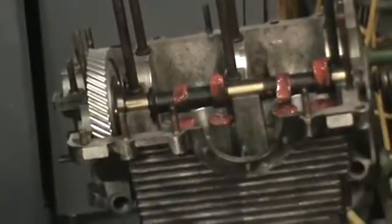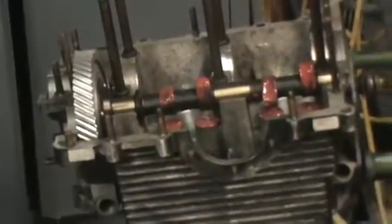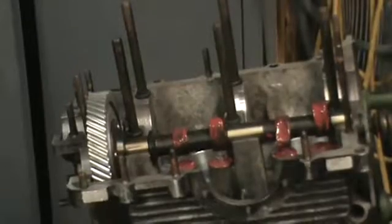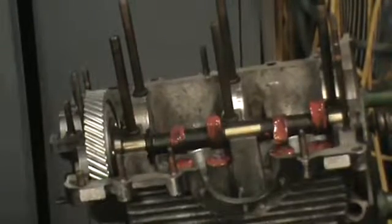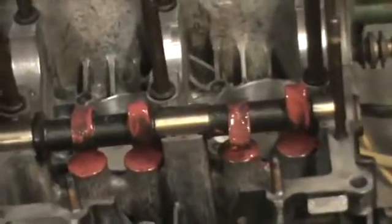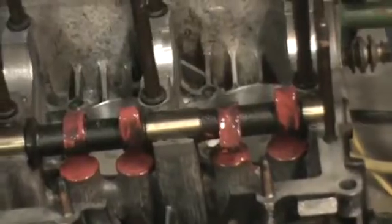All right, guys, I don't have a guarantee on the lighting. Here's the case. Got our lube on our cam. We got our bearing installed in there. We got our cam bearings in there. Our lifter. We got a cam plug set off to the side over here. Got some main stud washers. We got our main stud seals installed. See there. We're getting ready for our final assembly here on the 1915.